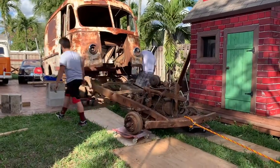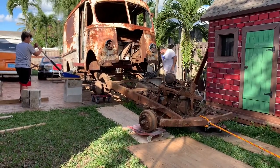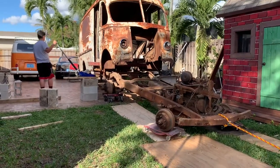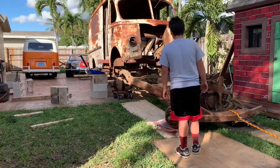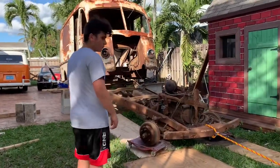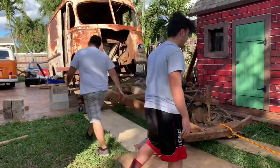Yes, it is a little sketchy, and I'm sure you can tell in the video that I'm a little stressed — I even got a little worked up with Noah because it was dangerous. You could see the Metro rock back and forth a few times. I kept telling Noah not to get underneath the Metro. We basically pulled it out and mission accomplished, but it was definitely stressful — worth it though. We get to have a modern chassis underneath it relatively inexpensively, and if something goes wrong on one of the long road trips we plan on taking, we can go to any auto parts store, tell them we have a 2000 Chevy S10, and they'll be able to get us any suspension part or 350 engine or 4L80E parts to get it back on the road. That's one of the big reasons for doing this chassis swap.